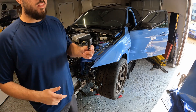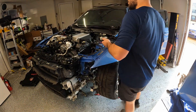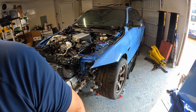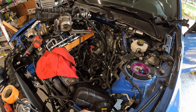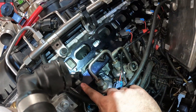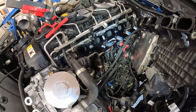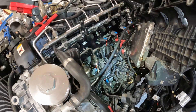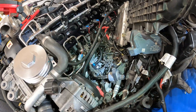I've been messing with it and I couldn't get the car to recognize the key — it kept saying it wasn't in the car, but it would then recognize it because it would lock and unlock. I got it to crank over, but shortly after it cranked I noticed a gigantic puddle of gas underneath. Figured it out — I managed to forget to plug the port here on the port injection, so it was just squirting out whatever 50 psi of fuel everywhere. Now I'll have to clean up all the extra fuel all over the block.